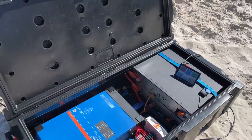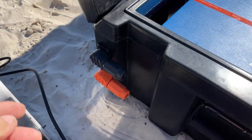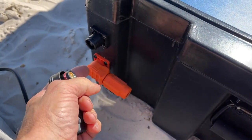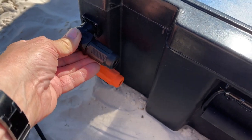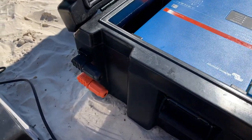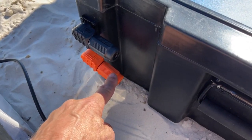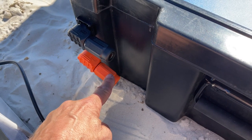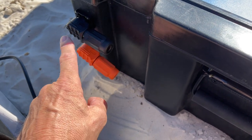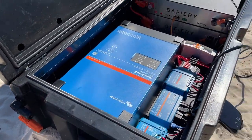And that's charging this. Now there's one other charging source in here. What we have coming in on the side are these two Amphenol connectors — let me just pull one out. There's the positive, and these are coming from the alternator. Inside this case we'll put our Killer Wasp, and this will pull 80 amps out of an alternator — that's perfect for nearly every vehicle running in Australia. That goes to the chassis ground. So you just unplug these, pull the case out, put it on the beach as we've got here now, and we're all good to go.